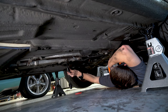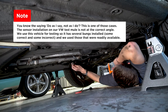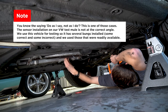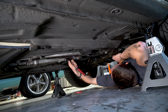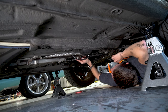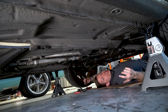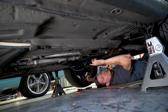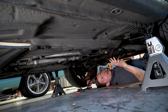Unplugging the sensor, breaking torque, and unscrewing it the rest of the way. Taking our good sensor and threading it in, making sure it's not cross-threaded, then snugging it up. Using our O2 sensor socket, we get it on there — it doesn't take too much force, just enough. Make sure it's tight. Then get a couple of zip ties to secure the harness. Make sure any extra harness length is zip tied up and out of the way, away from the hot exhaust — a harness dragging on the ground can damage the sensor and take out the gauge itself.